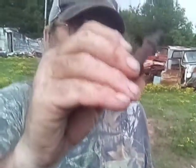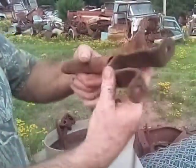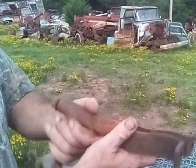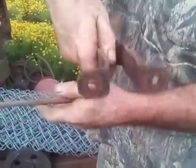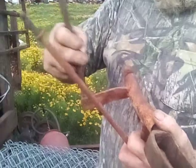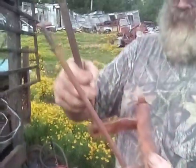And then on the engine side, use this piece right here. Hold still. Okay. It fits in right there. On the 6-cylinder, the original 6 with a stick had this apparatus on them for that Z-bar. And this rod right here is the one that goes back to your clutch fork. And the rod coming down from the engine, it fit right there.